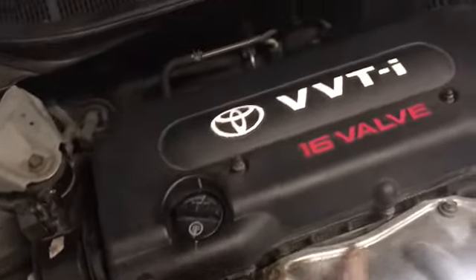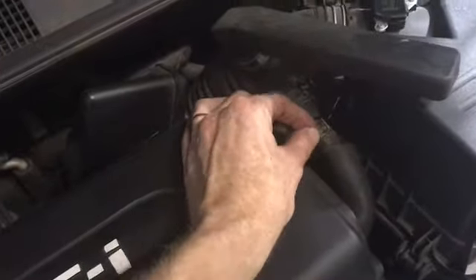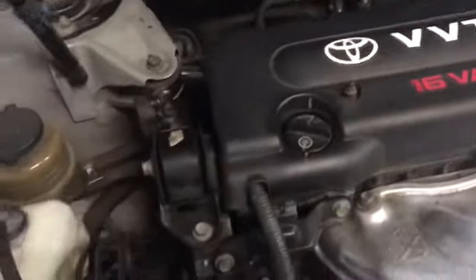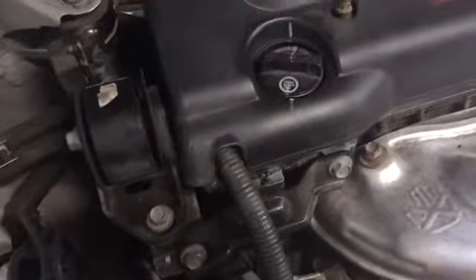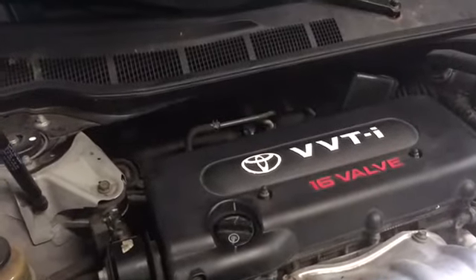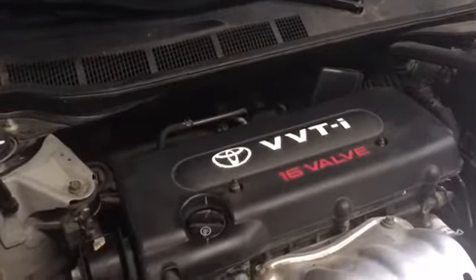The cover's back on. Tighten those bolts in a star pattern. Don't forget your PCV valve hose and the air intake. You may have to squeeze the hose together to push it back up in there. There's also a gasket under here on the gas cap which may be worth replacing. Make sure you've got the wiring harnesses secured — one's here, one's under there, and one's under there. And that's really all there is to it. About $20 for the gasket, $25 depending, and a couple of tools.